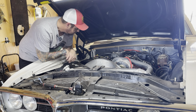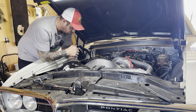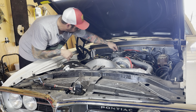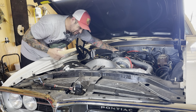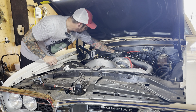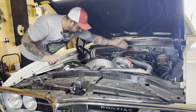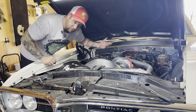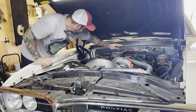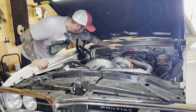We're going to use this white wire — the yellow one is going to go away. Now that we've found it, we're going to start doing a little disassembly. We're going to bring the engine up to number one on top dead center. I traced my number one spark plug wire to see which one it was, and it looked like I might have had the distributor 180 degrees backwards when I originally installed this. That's low-key embarrassing, but it is what it is — it works either way. So when I install the new one I can either put it in the same way or fix it. Let's bring this around and take the old distributor out.